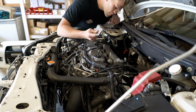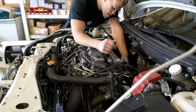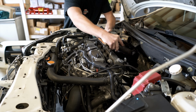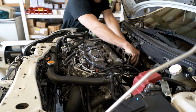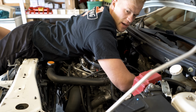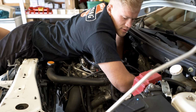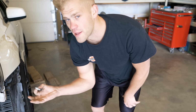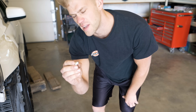Alrighty, number one, we gotta get this gasket back on here. It's just a metal gasket, which I'm reusing. And then from there, we can get the manifold on. I am just reusing all the factory nuts and washers from the stock manifold on this ETS manifold. It'll all be the same. One thing I want to do before I get any farther, before I get this manifold all the way on, is get this oil feed line little fitting on to the head.